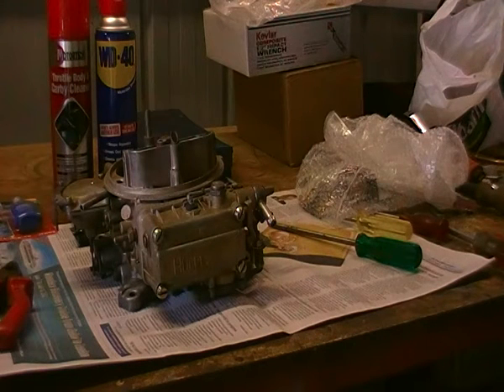When this carburettor goes on and it's properly tuned, it probably adds two miles to the gallon, so that's about 14. We think we can get it above that by adding a twin pipe exhaust system with much lower back pressure, doing some work on the distributor and the timing, and then I'm going to add an HHO hydrogen kit, which should make another 10 to 12 percent difference minimum to the fuel consumption. So we think we can get it up to around 18 to 20 miles to the gallon with a little bit of judicious tuning.